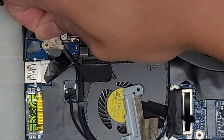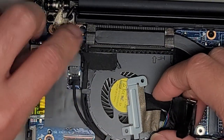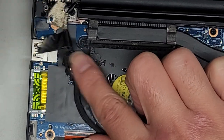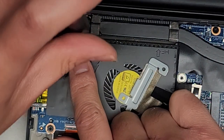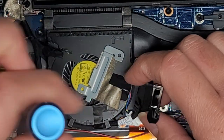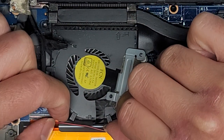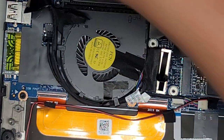We will have to take the hinge screws out. Let's peel this adhesive off as well, and we're going to have to disconnect these cables and get this out. To get this out it's going to be somewhat of a pain because the fan is on top. Let's peel the adhesive here holding it in place. Here you can see there's a fan screw under here — this is also JIS0. We're removing the screws just to make it easier to lift the fan slightly so we can get the cable out.